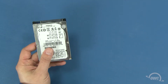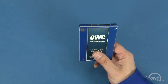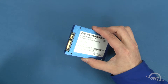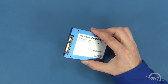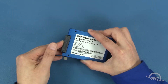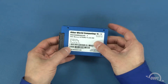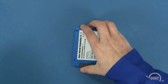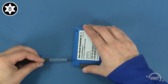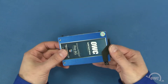We can install any 2.5 inch SATA drive, whether it's platter based or solid state. For this installation, we're going to use an OWC Mercury Extreme Pro 6G SSD. First, take the ribbon cable you removed from the original drive and attach it to the new one — it should just slide into place. Next, with the ribbon cable side facing away from you, rotate the drive 90 degrees counter-clockwise and attach the two mounting pins on that side.